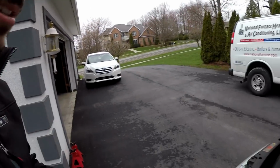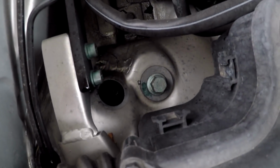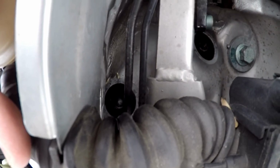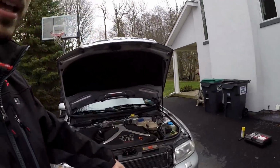All right, guys, so those rubber pieces are taken out. Anything that's rubber and glued to the car is always a pain in the neck, and they're pretty mangled up. So basically I just hammered a needle nose into them and pulled them out, and as you can see, they are open now, and some pretty rusty lock nuts are on there. I did spray some penetrating fluid on it, which I know we will need a lot of, especially when we get down to the control arms, because since we won't be loosening the pinch bolt, we are going to be loosening the lower control arms to wiggle that out. So now I'm going to jack up the car, take the two front wheels off, and get started on taking that assembly out. Let's do it.